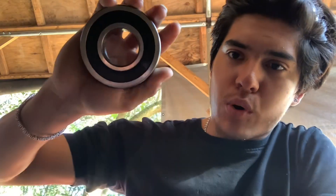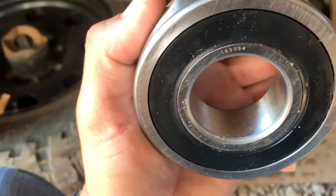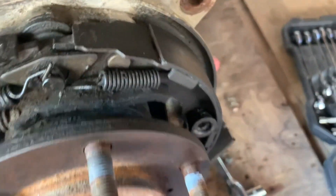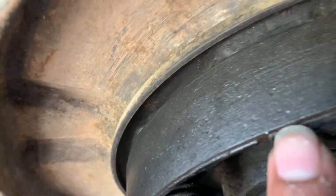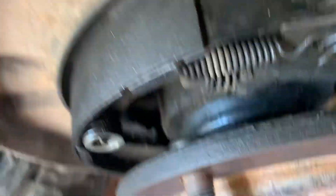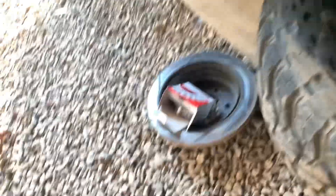That's a big boy, look at that thing. This is obviously going to go in here in the rear hub. But in order to do that, we must first remove the parking brake shoes, which are also getting replaced. They look okay, but they are covered in a very thick layer of grease and oil from where the bearing seal has been leaking — pretty much all of the inside is covered.